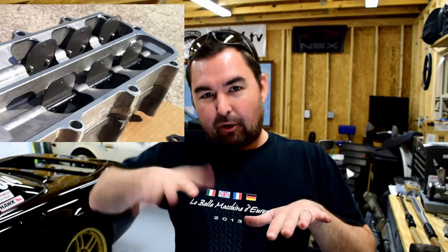Number three: the wayward intake butterfly screw. The first-generation NSX uses a variable volume intake system that uses an array of butterfly valves to subdivide the intake manifold. These butterflies are attached to an actuator shaft by a couple of small screws. There have been a number of documented cases of some of these screws coming loose and attempting to depart the engine by way of the valves and cylinders. The consequences can approach or include an entire engine rebuild due to damage to valves, cylinder walls, or piston heads. The way to mitigate this for a stock motor car is regular inspection of the butterflies and screws by way of a bore scope inserted through the throttle body. If you're extremely paranoid or going to a forced induction build, you can just delete the butterflies altogether — just understand that will impact performance. I had Source 1 take a look at my throttle butterflies while they had everything else apart, and everything appeared to be in place, fortunately.